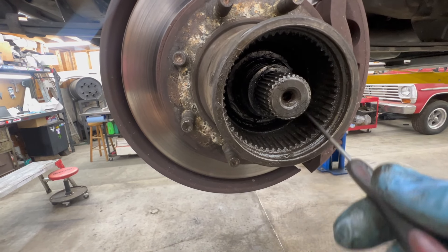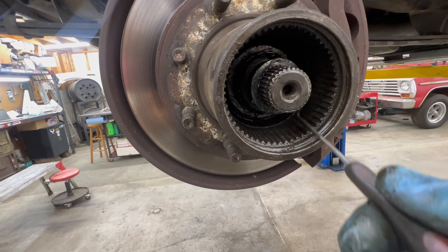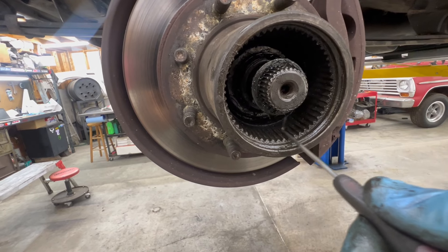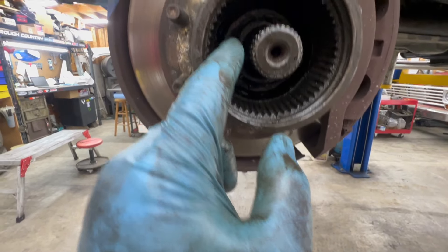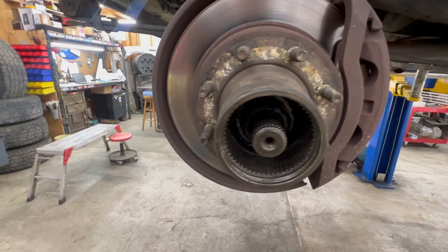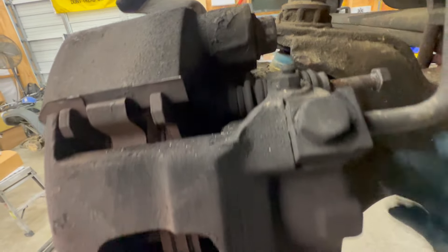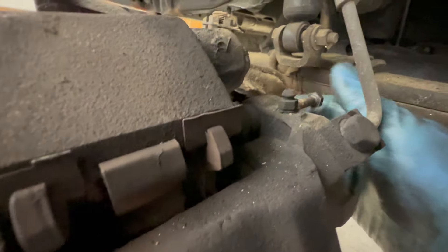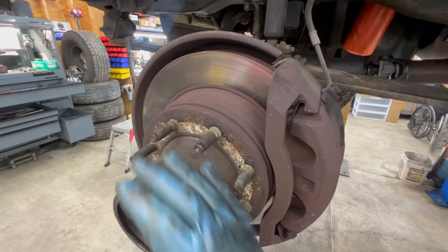It's been a while since I've done these old school ones — it makes you kind of appreciate the non-serviceable hub. I really think it's more heavy duty than this, and it's definitely a faster job to do. So now we're all the way down to removing our nut, our stop nut there on the back that you seat your bearings with. We're going to pull our brake caliper off here. You've got a 13/16 top and bottom on your caliper bracket, and both of your actual caliper bolts that go through your sliders are half inch. We got all those loose, now we're going to slide our caliper off, set it up on the leaf spring and strap it down so it does not fall off.